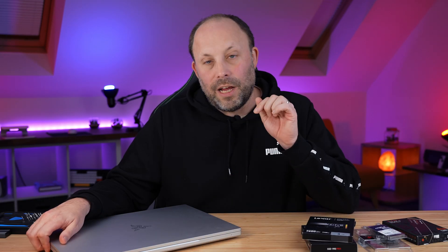Stick around, let's open it up and start testing. Before I open up this laptop I want to make sure I've got everything prepared. Because I'm upgrading the RAM and the SSDs, I want to make sure I've cloned the primary drive to my new drive to make sure everything is in order before I even open it.